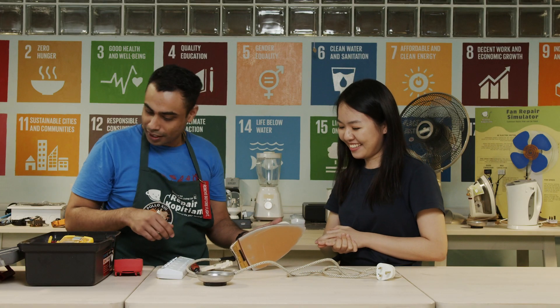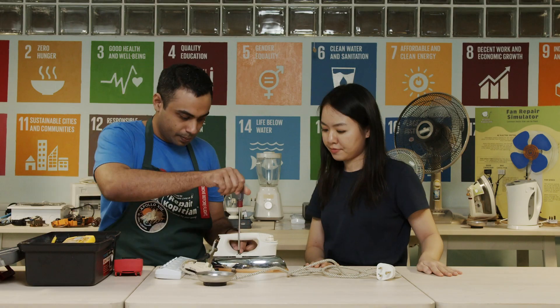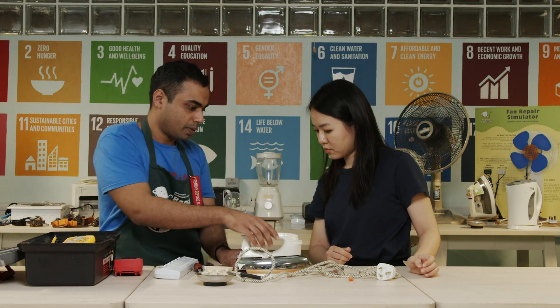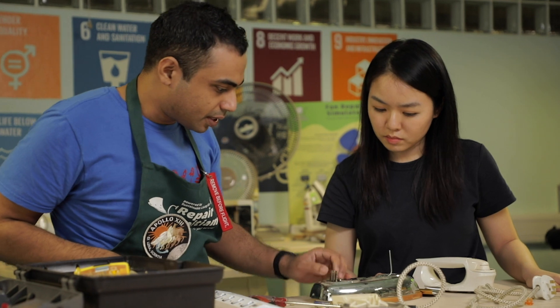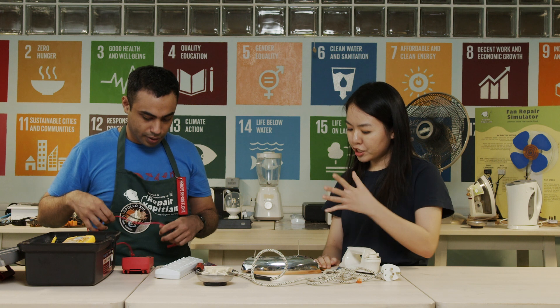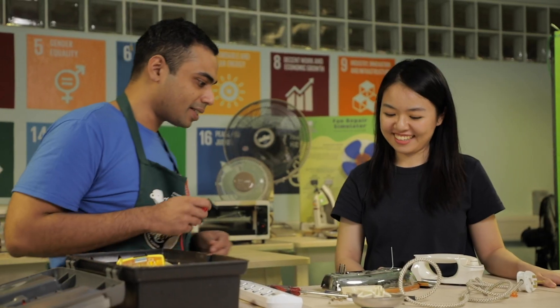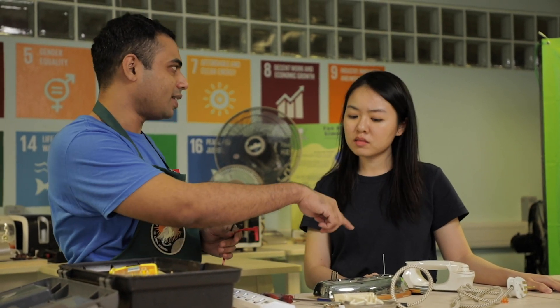Now I know how not to have extra spare parts after a repair! I do not see any obvious burn marks or any loose connections, so let's begin with checking our heating element. Do you remember your Ohm's law? Yes. That's the basis of how we check the heating element — the value we're trying to find is the design resistance of the heating element.